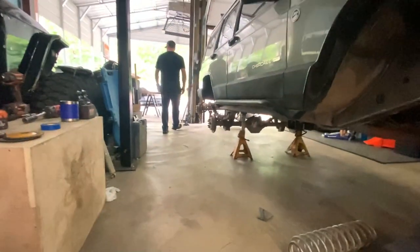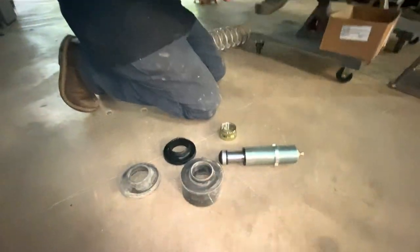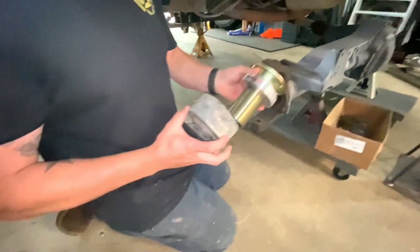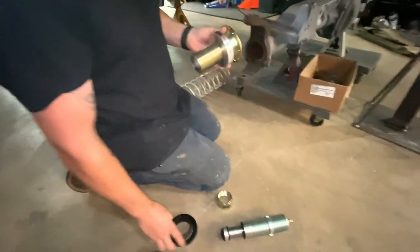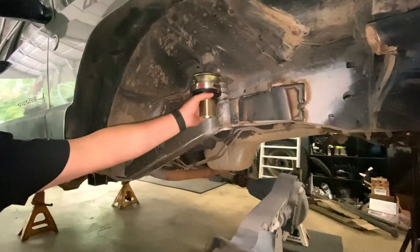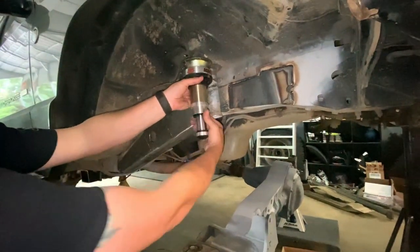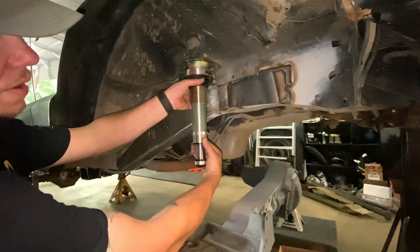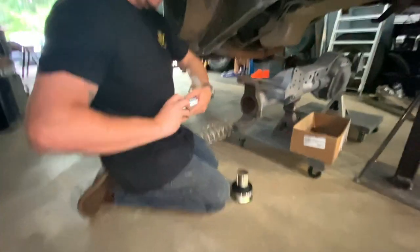But I think you might be able to use these coils, because that's exciting news. You have your original coil spacers, which technically we can cut the center out, slide this over, and be able to adjust even more. Oh, wow. If needed. For instance, say you cut this piece off, this bolts into place, welds, bolts, whatever you wanna do, then your bump can goes in and you can adjust your bump all the way down to here. This is gonna be so cool. So cool.